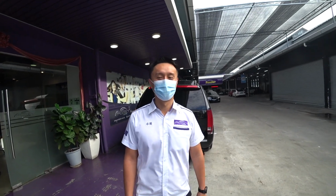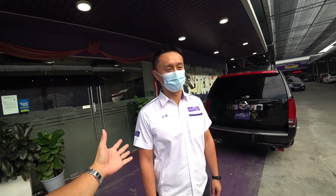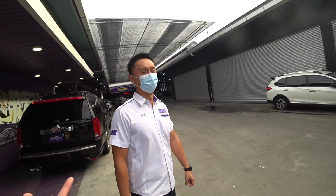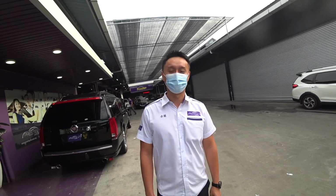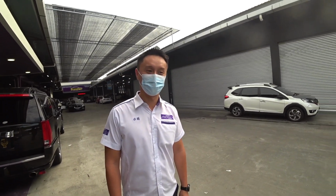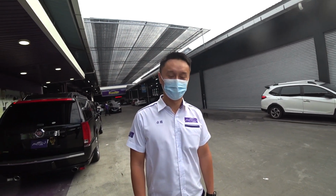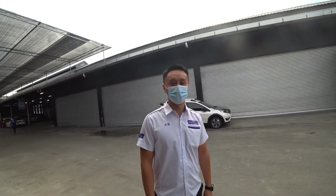So guys, if your premium car has anything you want to understand or know more about, look for Wai or Mr. Toh. Everyone calls him Mr. Toh here. He made a very, very good video that day explaining to people why some of your F10 generation 5 series make loud noises from the aircon. A lot of workshops will charge you a lot for it, asking you to change this, change that. But actually, just removing the filter and the blower to clean it up would help a lot already. High chances. Yeah.